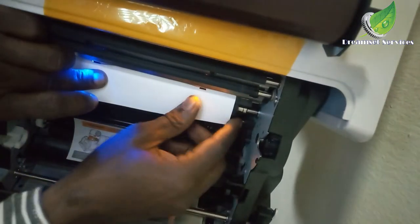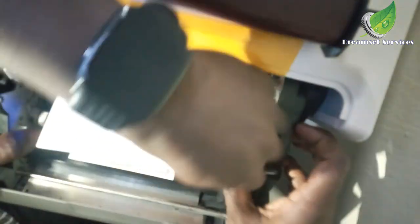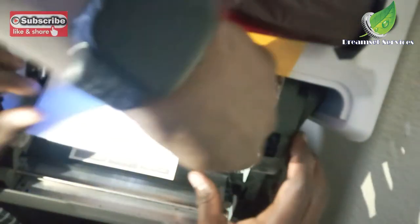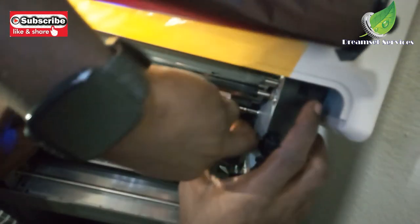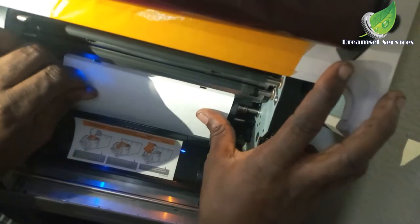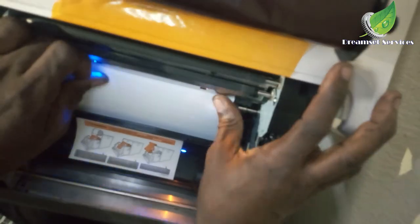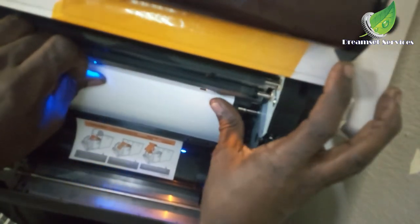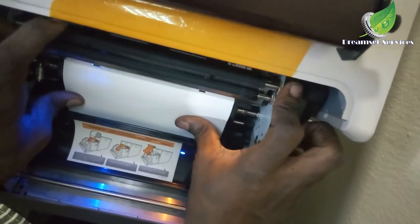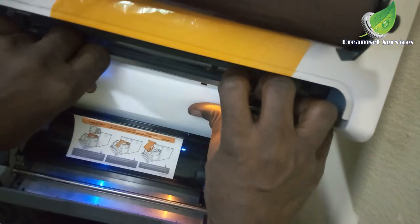This is the photo paper. I'm going to refeed it inside the slot — you can see there is a slot there. It is supposed to pass through this part of the machine and go in through that particular hole. If it didn't go in through there, the sensor will not be able to detect it. I'm going to pass it through there, close it up again, and confirm if the problem has been solved. If it has not been solved, the next place I'm going to check is the paper sensor — you can see there is a sensor on the right-hand side and the left-hand side, visible with a blue light.